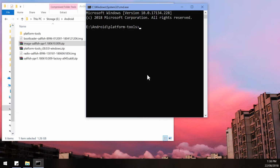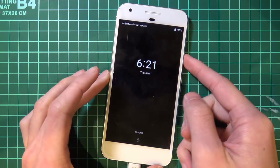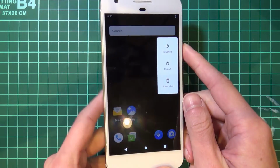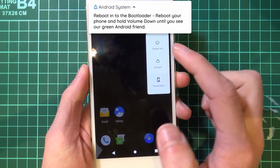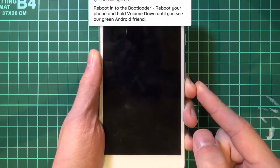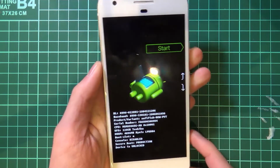We're going to go ahead and boot our phone into the bootloader. So just follow me here to our phone. We're going to basically power it on. You can see I'm on Lineage OS. I'm going to power off the phone. Well, actually you can plug it in and tap on restart and hold the volume down button. Just keep holding it until your phone boots into the bootloader.